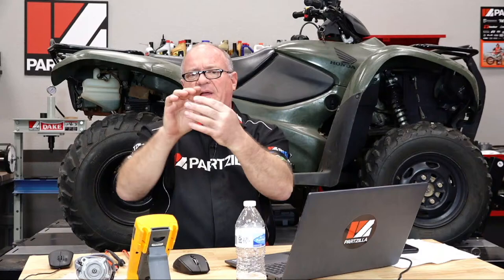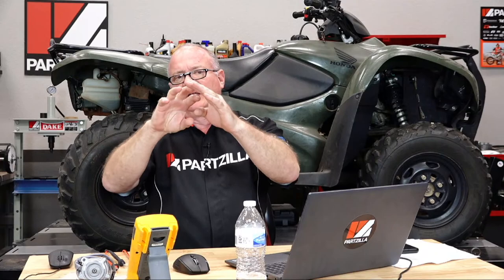Sam is asking me, what are some signs of a bad starter clutch for a CRF250X? What parts on the starter assembly usually go bad for that model? The starter clutch is basically, it looks like a bearing on the inside, and it's got a ring on the inside. And when you rotate this way, I don't want to call them bearings, but it almost looks like a spindle bearing. It'll let it flow one direction.